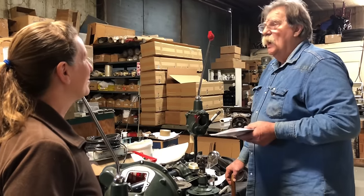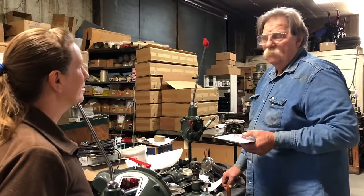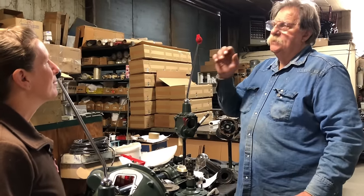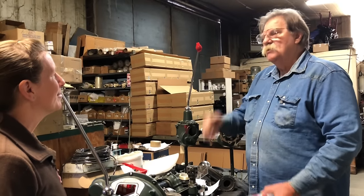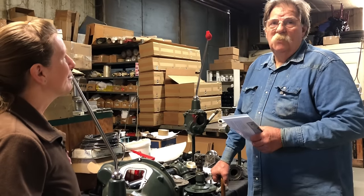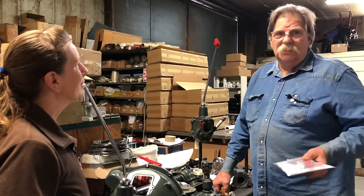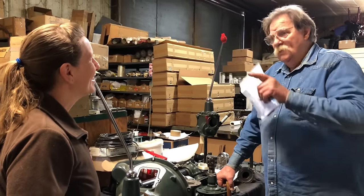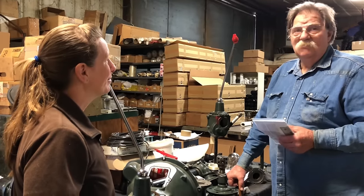These seals are included with the gaskets — very necessary. We had no idea when we first started how badly the transmissions would leak. There were a couple of old write-ups using things like copper pipe end plugs pushed into the hole to return the oil. It's actually significant — way more leak than you'd expect. For example, if someone puts in a new engine and oil runs out the bottom of the bell housing, you can't tell if it's from the transmission or the engine.